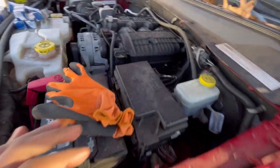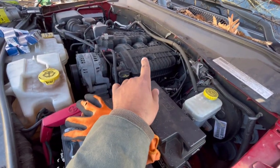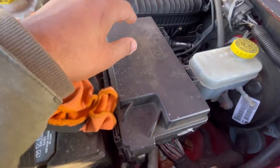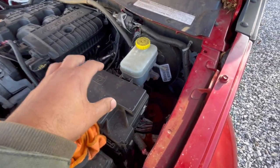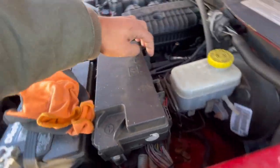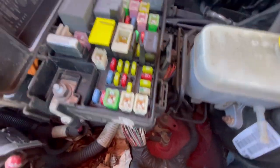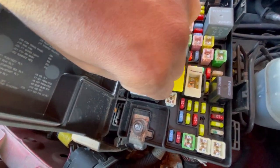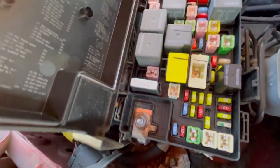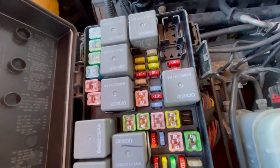So first things first, before we start taking anything apart, this is for the 4.0 motor, the V6. The fuse box is located on the driver's side, right behind the power steering. To open it, push each tab backwards, and then we're gonna get a fuse puller like so. Under here it says what each fuse is for, so we are looking for either a fuel pump or EFI